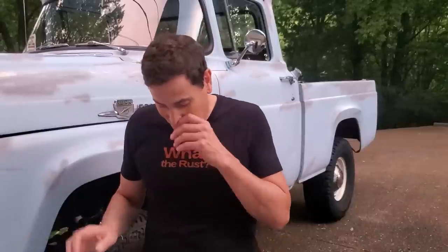So I was dressed way too nice for taking wheels off. I have no idea what I was thinking. Don't dress like that if you're gonna take wheels off an old vehicle. But it's important to know a few things. Always change brake hoses. If a vehicle's been sitting more than a few years, change them. They're cheap, and it's just simple insurance for safety.